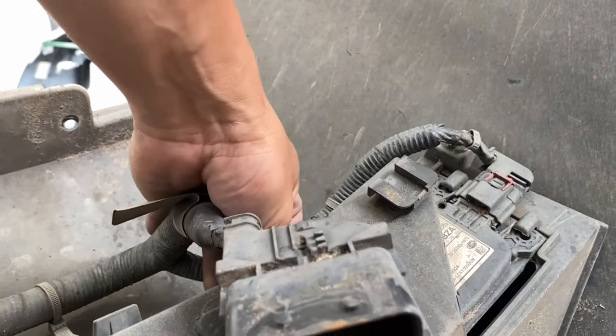These clips right here — you're going to take them off the old bumper and then put them back on the new bumper. There are going to be a lot of them; some on this side but this one's broken. Also, one thing I didn't catch on camera: there's going to be a little module right here that was right here that you'll need to transfer.